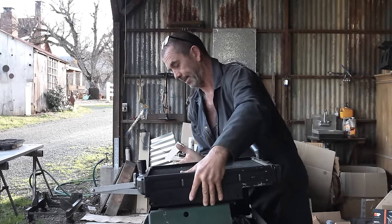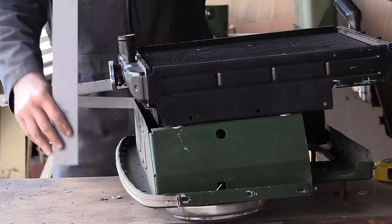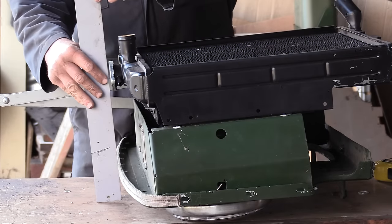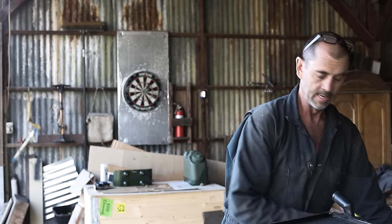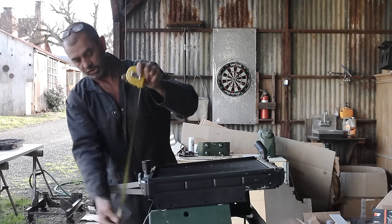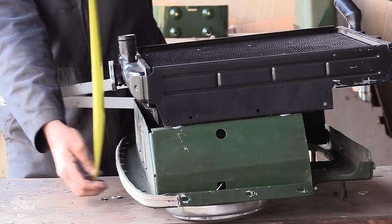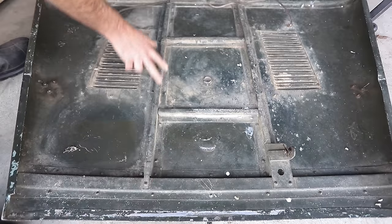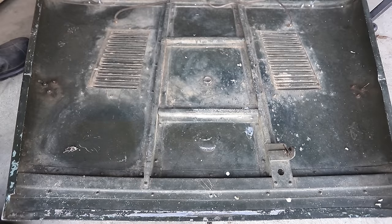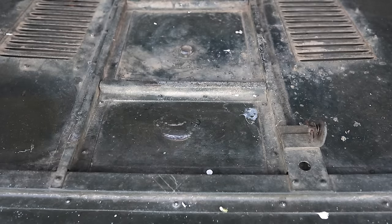All right, so we put that there. All right, so our bonnet is going to be there, and that should give us enough clearance for the radiator cap. Its measurement from the top of the front grille is around 8 inches. So if we measure that to the bonnet, we will make sure that it doesn't interfere with any of those support brackets and sits right in the middle of that little pocket, so to speak.